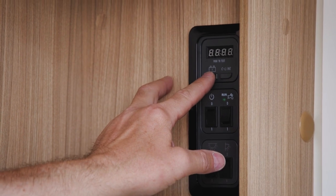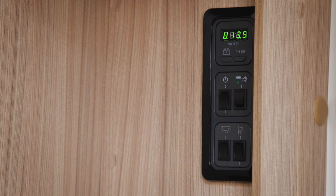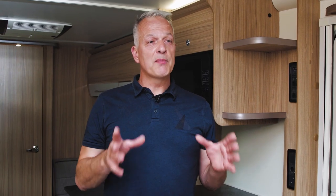There is also a battery voltage switch. If you press the battery switch you will get a reading — we have 13.5 volts at the moment after using the mover, and a fully charged battery is normally about 13.8 volts. So that covers the power to your caravan, from a 230 volt hookup to a 12 volt supply. You are now ready for your holiday.